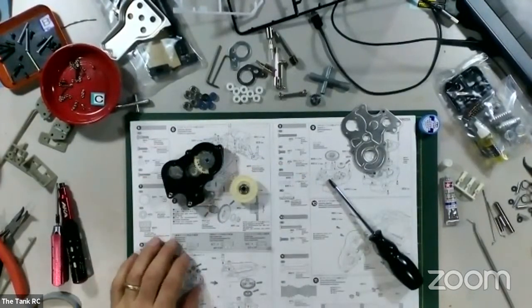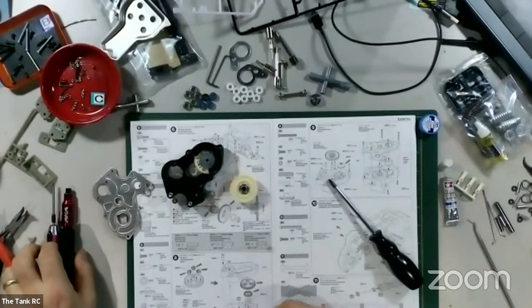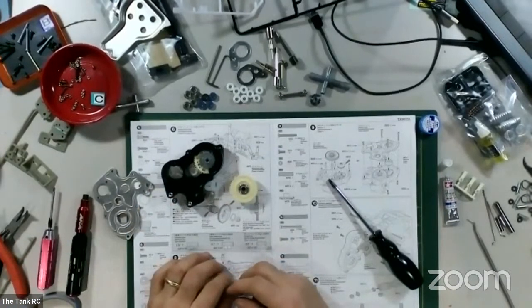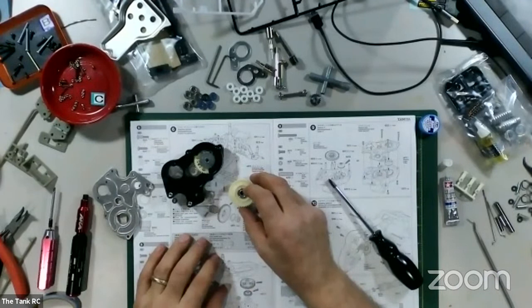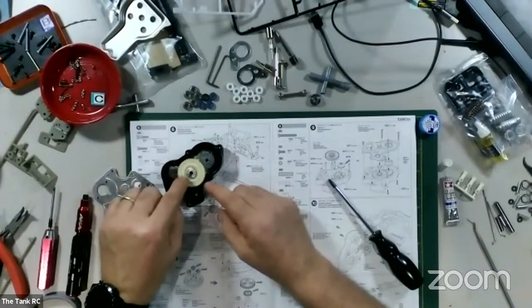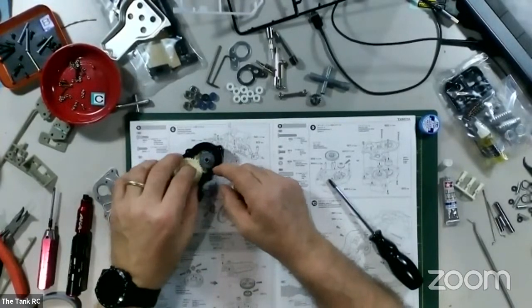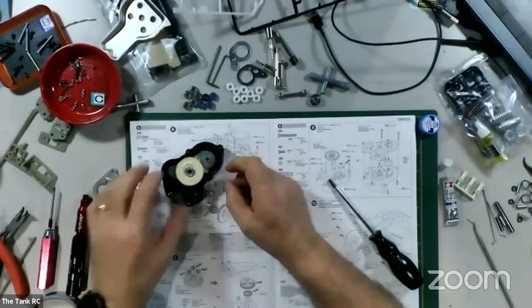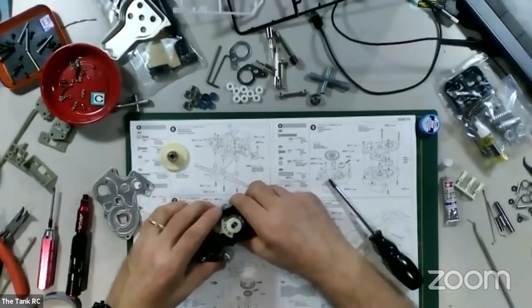This is a Tamiya, right? Yep. So is that like a basic Tamiya transmission, or are they all totally different from each other? All the ones that I build from different kits are different. So this is a two-wheel drive transmission, which is pretty close to a Traxxas, which usually has the three gear transmission. This is basically just two, because you have the spur gear that goes to another gear that's actually attached to it, but then that goes to the drivetrain. So there are basically three gears, but you're going to have the motor directly on this that's going to turn that. So it's a little bit different than the Traxxas, but they're pretty close, all the same. It acts like an idler gear.